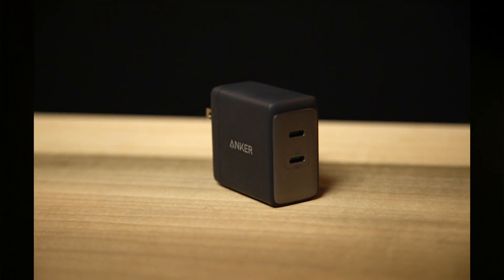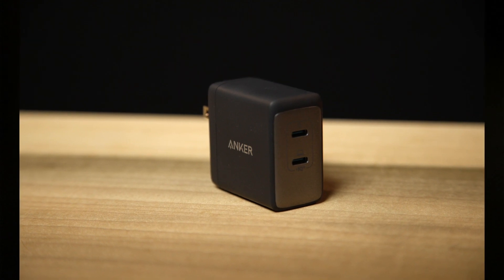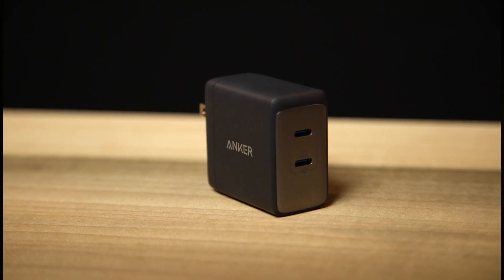Ultimately, this changes what I can recommend for powering the camera. Basically, you need a charger capable of providing 27 watts or more — specifically 3 amps at 9 volts if you're digging into the specs — but that should be covered by those power rules so any charger that's 27 watts or higher should provide that. I'm currently using an Anker Powerport 3 65-watt two-port charger, which I can confirm works properly for both charging and powering the camera, this time based on actual current measurements and not just guessing based on what the manual says the camera kind of should display. I'll put a link to the specific charger I'm using in the description below.